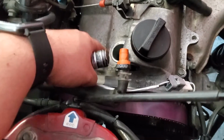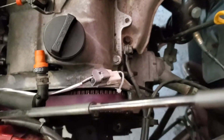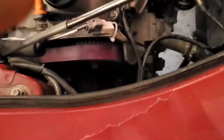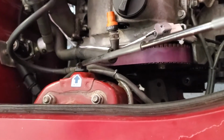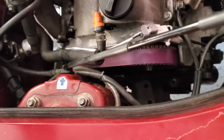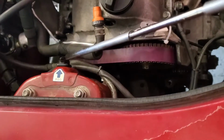We had cylinder number 1 at top dead center, compression stroke. So we had the cams all zeroed out, and down there was kind of zeroed out. And then on the dampener, I went back a little bit, put in the piston stop, and now we rotate. I marked it, I just randomly marked it there. So now we're going to rotate the engine all the way back until we stop again, mark it, and then between the first and the second mark, half of that should be top dead center. Cool? See if it works.